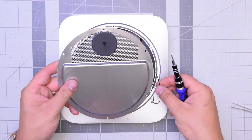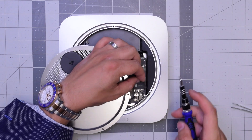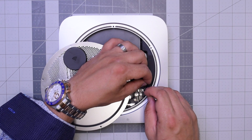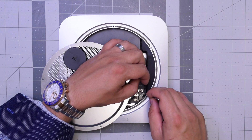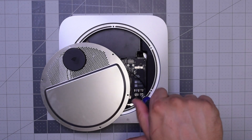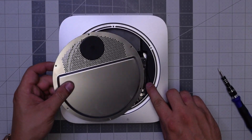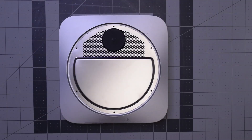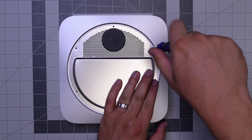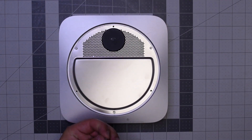With those three secure, let's go ahead and reattach the Wi-Fi antenna. Go ahead and align it with the Wi-Fi and Bluetooth cord. Guide it in and make sure it pops in nice and firm into that socket. Twist it in and align that little retainer hole, because we're going to need to secure the last T6 screw right there. Then tug that cable in a little bit.